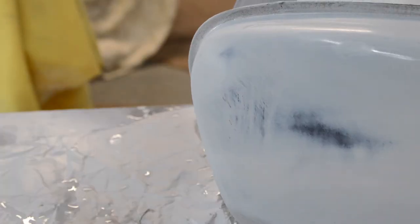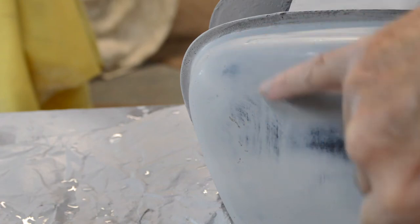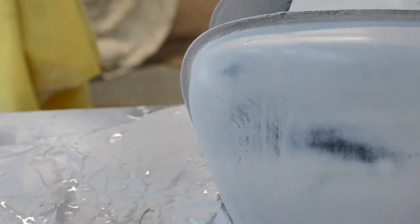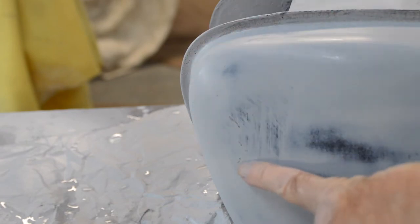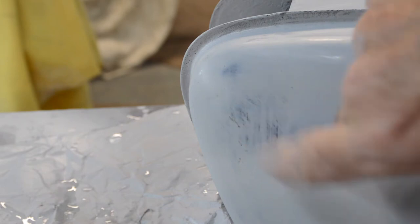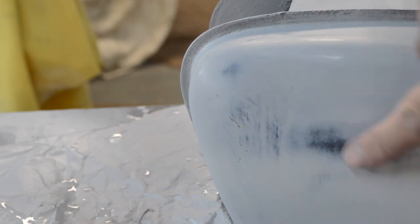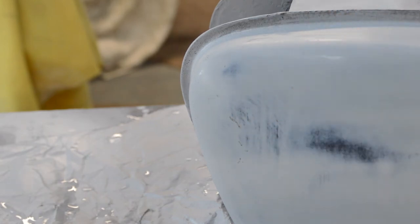I was hoping for something a little more clear cut but anyway - to give you an idea of why I'm bothered: this is the corner I filled. It's nice and smooth now, there's no evidence of mapping around the edge or anything like that, so I'm very happy. I've gone down right through to the etch and beyond. But you can see one, two, three long little scrapes which are still filled with the black paint, as opposed to the etch showing through - these are little pinholes in the filler which we have to get rid of.